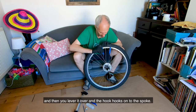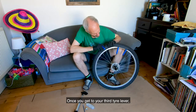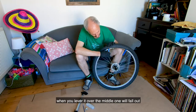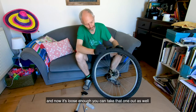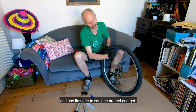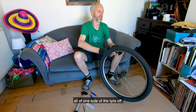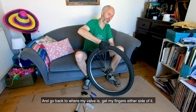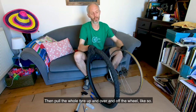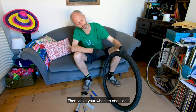Lever it over and the hook hooks onto the spoke. Once you get to your third tire lever and lever it over, the middle one will fall out — and now it's loose enough you can take that one out as well and use the first one to squidge around and get one side of the tire off. Go back to where the valve is, get your fingers either side of it, pull it out of the hole, then pull the whole tire up, over, and off the wheel. Leave your wheel to one side with the valve at the top.